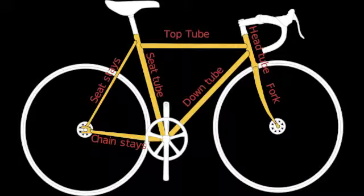Make sure the spot you choose won't interfere with the movement of your shifter and brake cables, and that your U-lock won't be in the way of your moving legs. Once you've found a good place where you'll hang your U-lock on your bicycle, and you've oriented the black plastic bracket and the swiveling piece of metal on your U-lock to their proper positions, you can start the mounting process.